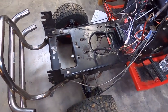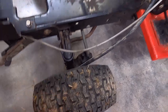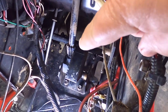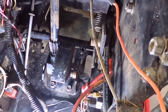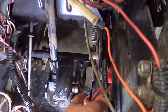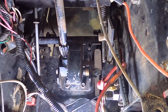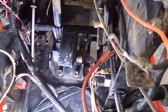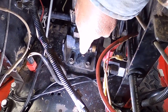Looking for my steering slop — I checked the front end, we've got a little wiggle there that's not bad. But this convoluted gear piece, this is where all my slop's at. You can see how this piece starts moving before the pivot arm does, and there's some slop in that bushing. I did put a set screw in it at one time.